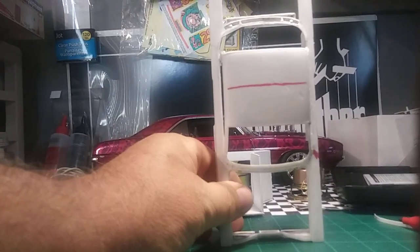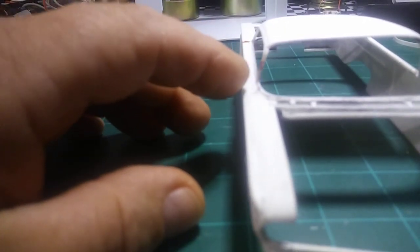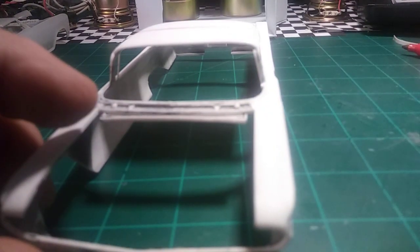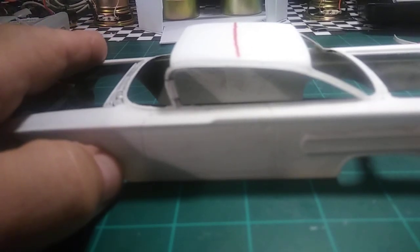If you've got posts that are spread out - this one has a little bit of a spread but you can bend it a bit. When you have posts that are leaning really far in, then you're going to have to do some cutting on the roof to get everything symmetrical. What I'd call a square roof chop is just a straight-shot drop-down.